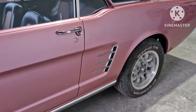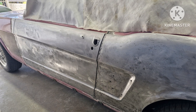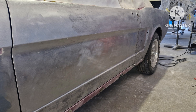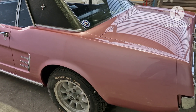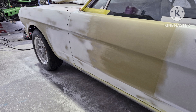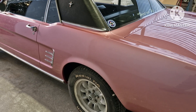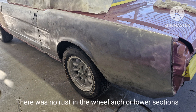Got into it and there was just body filler for days. It makes you wonder why they'd put so much filler in when it's easy to just hit it out and fix it. The left-hand rear quarter — if this car was an empty shell I would have replaced the quarter, but we left the glass in and the vinyl roof. This is just a driver-quality car, so I persisted with the hammer and dolly and actually got the quarter panel really neat.